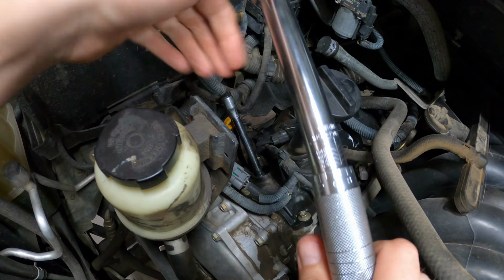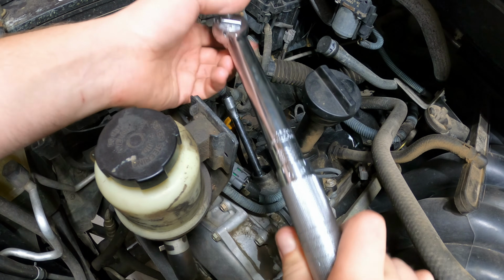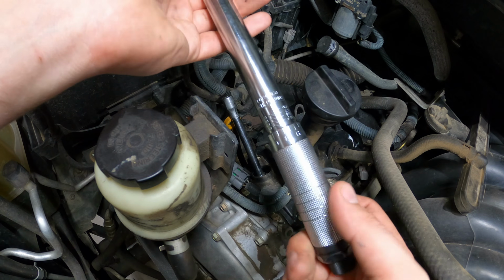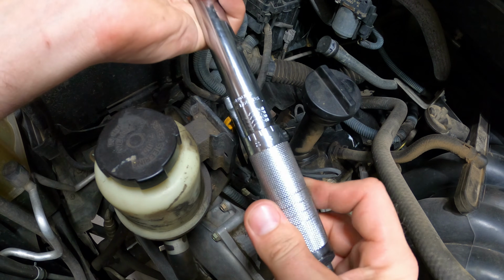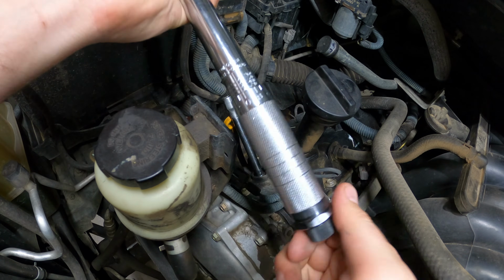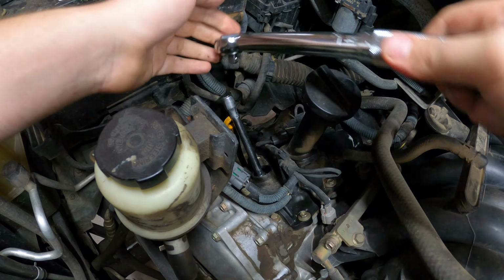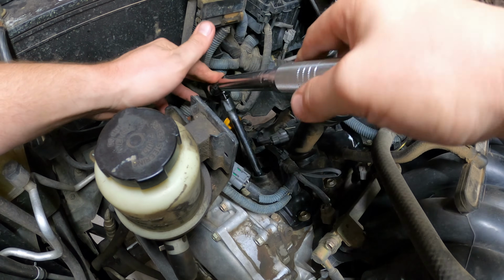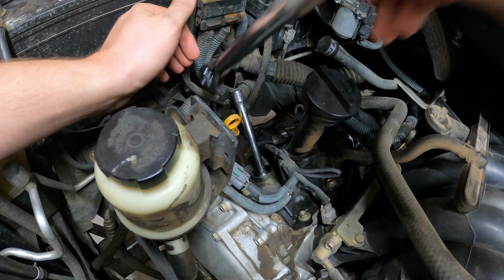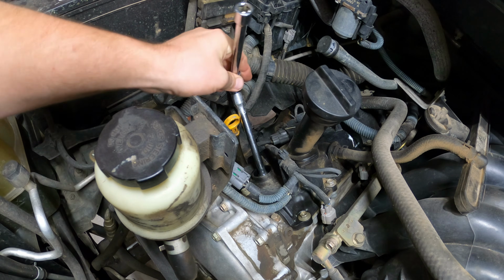All right, so according to the Googler, this is supposed to be down to 18 foot-pounds, which equals about 216 inch-pounds, which is what we have here. It's an inch-pound meter, and the nearest measurement is 240, so we're gonna try and go to just under 240 inch-pounds. Okay. Now we're going to put this in here and see if we can reach it and make the clickety-clackety magic happen. Not really, so hold on. So we're going to try and make this wobble magic work here.